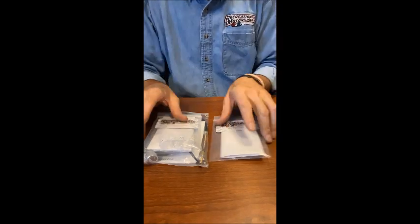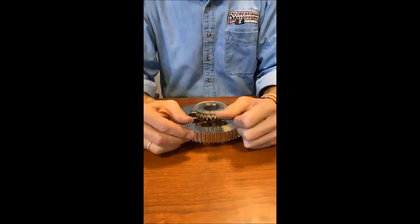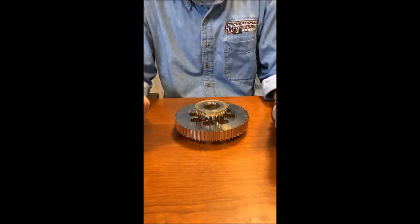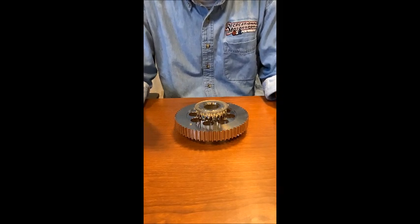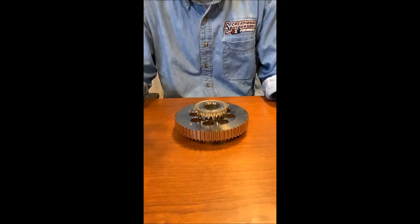That's number three. Those three items work very well, and you're going to see probably 2 to 4 mile an hour gain overall. And I can't stress enough, if you have a new sled, you need to give it time to break in. After about 300 miles, the track loosens up, all the bearings loosen up, and you're automatically going to get some speed.